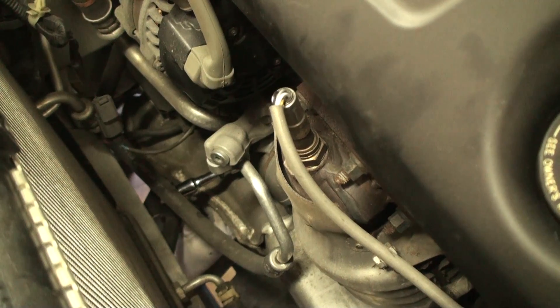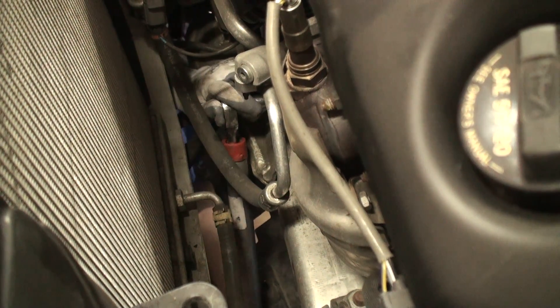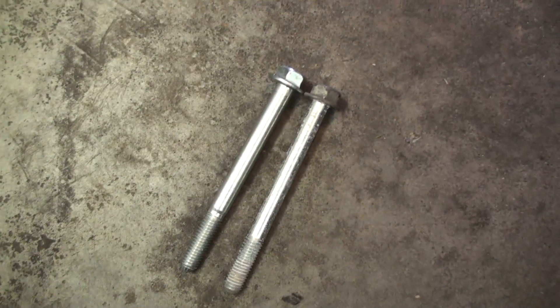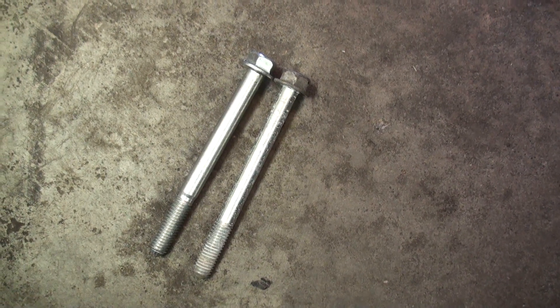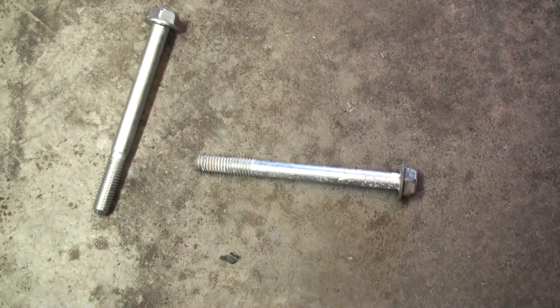From below the vehicle, begin loosening but do not completely remove the AC compressor mounting bolts. The socket size you will need is a standard 12mm socket. The bolts can be quite tight retaining the compressor to the engine block assembly, and you don't want to strip the heads. As a service tip, you may want to use a short piece of pipe on the end of your ratchet for extra leverage. We only loosen them first and replace one bolt at a time — on this TL, we only replace three out of the four bolts. Do not unbolt them all, otherwise your compressor will literally fall over.